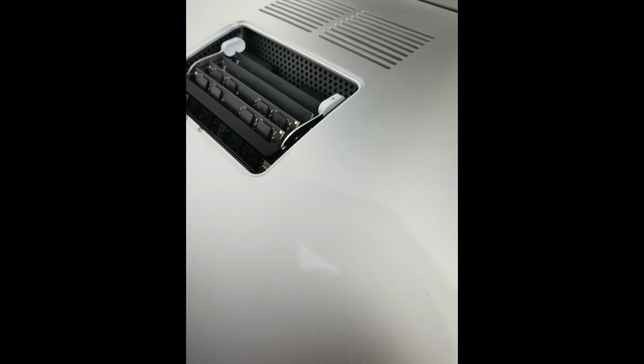Now you might be wondering, why didn't he just leave the 2 4GB sticks where they were, how they came with the computer, and just installed the 16GB sticks, the new ones, in the open slots? Well, I was told that the order matters, because if you put them in the wrong order, then it can actually slow down your computer. I was told to put them in this order, so that's what I did.